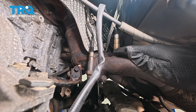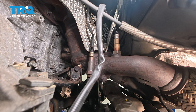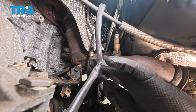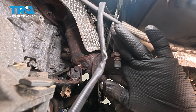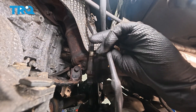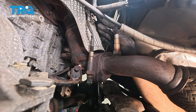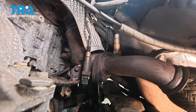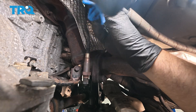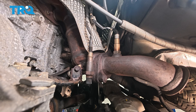At this point we can see there's no more gap between the O2 sensor and the flange, so we know we're plenty tight. Now we're going to go up top, disconnect the old O2 sensor from the upper retainer and harness, and install our new harness. Feed this up and put the harness into the retainer.